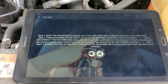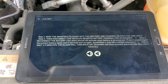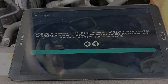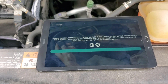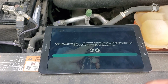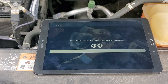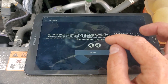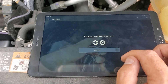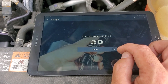The alarm is supposed to turn back on in a minute, and once that happens we'll have a 10-minute wait. While we wait, I just want to explain why my tablet is in the engine compartment — I'm Bluetooth connected to the smart box unit in the vehicle. I do this so I don't have to enter and exit the vehicle during programming. The key is already in the slot from earlier. If you do need a USB cable connection, I'd recommend leaving the door open and placing the tablet right outside or on the front seat.